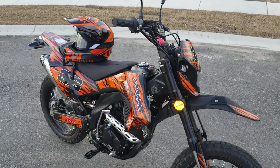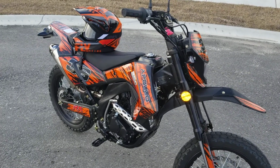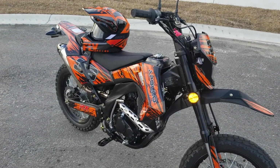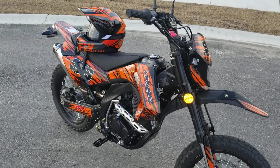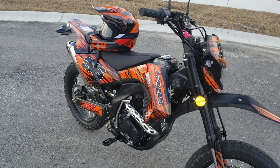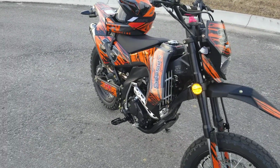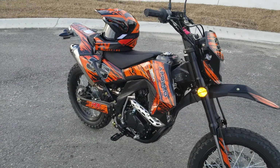So that was the whole issue the entire time, was improper ground. When I bumped it, it ran great. I took it off, ran good, put it back on, tightened it up, and it still started acting funky. So I took it back off, took a little Dremel tool, sanded the little spot where it was mounted, and I haven't had a problem with it since.